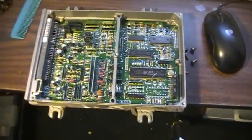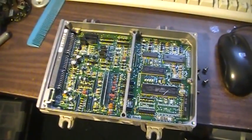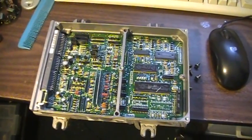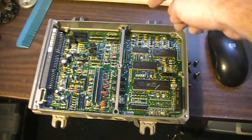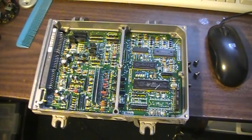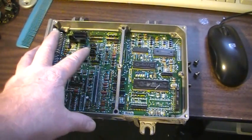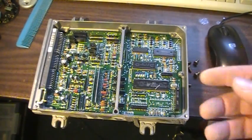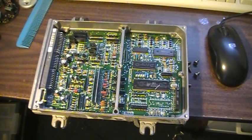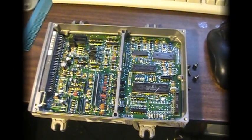If you're missing that sticker, you can focus on those numbers up top — that'll give you a big clue: OBD1, OBD2, what you're dealing with. Then you can tell what layout you have based on what ICs you have in place. This one you can tell is an automatic non-VTEC. Anyway, that's it — hope that helps somebody out.